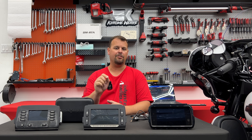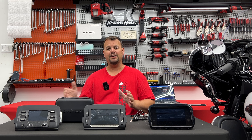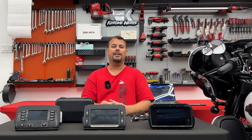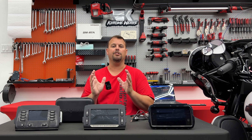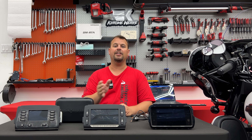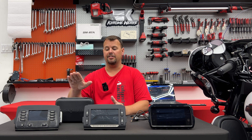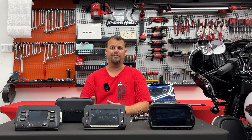They can do what they call the Rockford Fosgate flash, which I'll tell you later is not the flash you want to do when you install an amplifier. The Rockford flash is the factory four-speaker no-amp flash — the same setup that would have been on an Ultra Limited, Tri-Glide, or Road Glide Limited from the factory. They can also do some amplified flashes — the Boom Stage One, Boom Stage Two, or a flash for HD Audio by Rockford — but only if that factory amplifier is plugged in and seen on the data lines. So the flashing we're going to do through this series, they're all factory flashes from Harley. Your dealership cannot do those amplified flashes unless a factory amp is installed, which is not what you'll want to use when doing an upgrade.